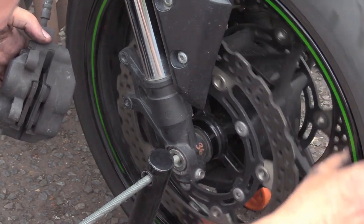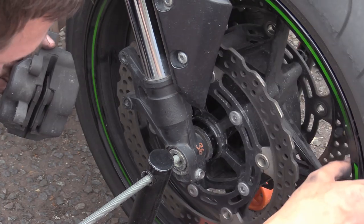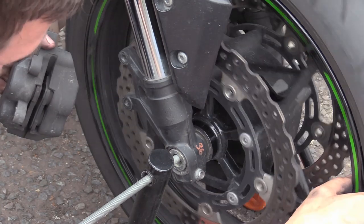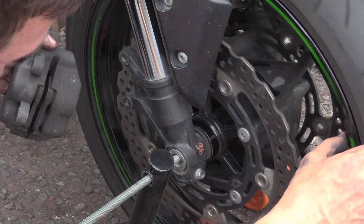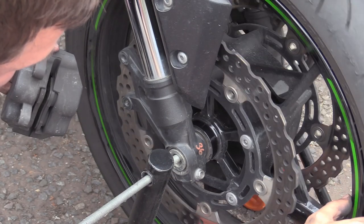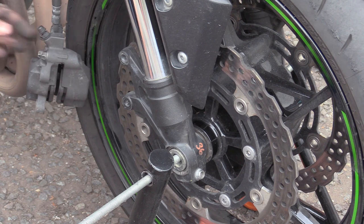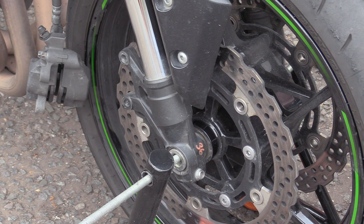So I write 36 on there because if you look at this tyre, let me find where it says. Road use only, front wheel use only. Where have the pressures gone? Or is it on the other side? Let me just check the other side. Make sure that caliper doesn't damage anything. Now be careful because my caliper's just dangling in the air. There we are. It says maximum pressure 42 psi when cold.